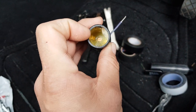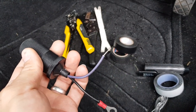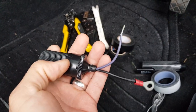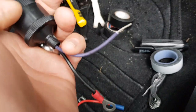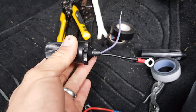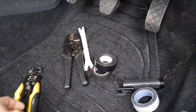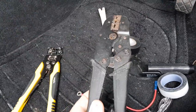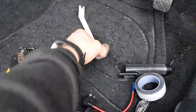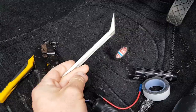This accessory socket is going to take the place of your original 12-volt socket. You'll plug into it off this end, and we'll connect this with a fuse to an ignition switched live feed for your dash cam to turn on and off with the car. Ideally you'll want to solder this in if you're going to use this type of kit. You'll also need some wire strippers, crimpers if you're using crimps, electrical tape, and a trim tool for removing trim and tucking wiring in. So that's the tools you're going to need.